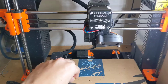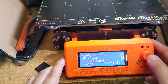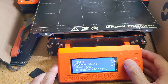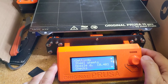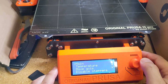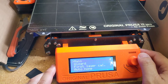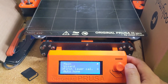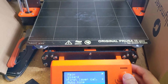Remove the tools from the cardboard bed. We can take off the cardboard at this point and go down to your settings. Change the sheet if you need to, then go down to settings, then hardware setup — HW setup. You're going to go ahead and change your nozzle size. I went up to 0.6. Make sure you have the correct sheet size. At this point, if you're a real stickler, you'll want to go to calibration and do your first layer calibration. I've been doing this enough that I don't always have to do that, but if you want to do it by the book, this is the time to do your first layer calibration. Load your filament and all that good stuff.